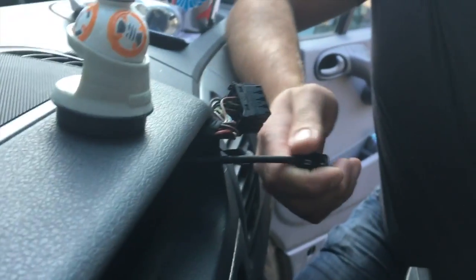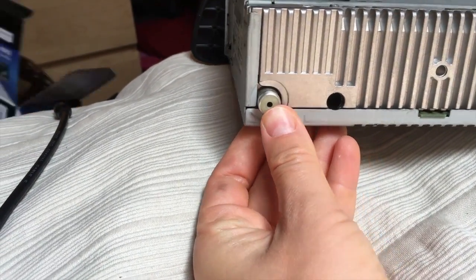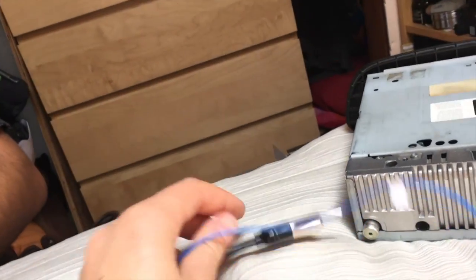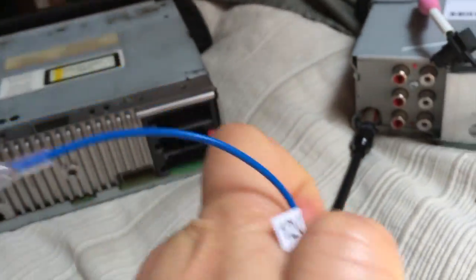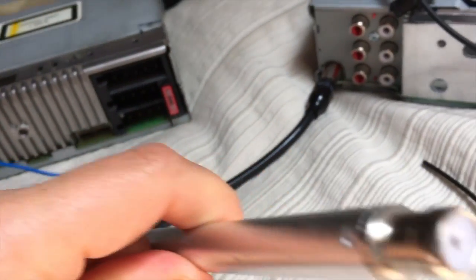You'll need a stereo and a new wire harness. We had to buy a wire harness for about $17 — not very expensive. That plugs directly into the standard plug you'll see once you pull the stereo out. The new stereo also has a built-in plug for the FM radio antenna. It didn't come with an adapter, so Michael bought an Audi/BMW/Volkswagen antenna adapter cable. That plug goes into the back of the stereo, and the blue wire connects to the power control to get the FM radio working.